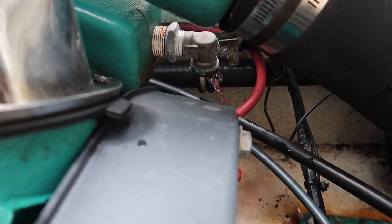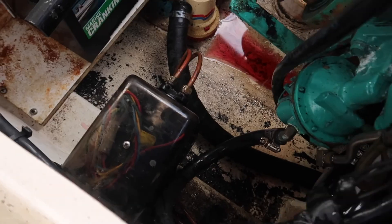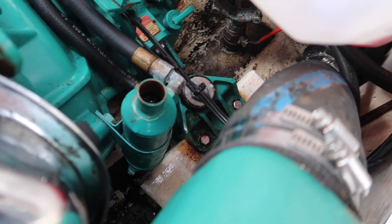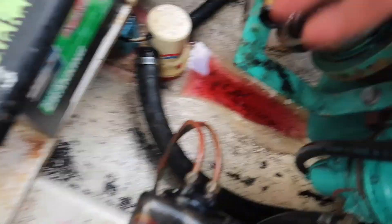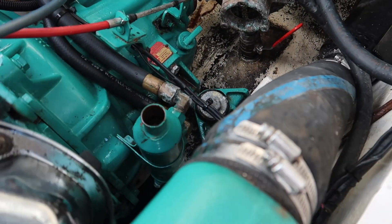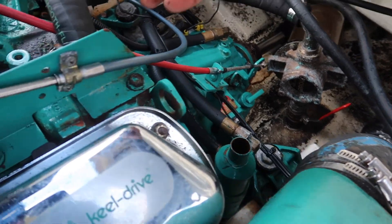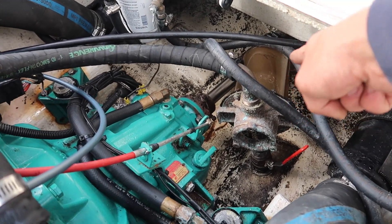The last thing: this hose runs up to the power steering cooler, so I'm going to dump some antifreeze in there just in case. You can see it's coming out pink — now we know that whole line is done. That's not strictly necessary but it's an extra precaution. Then I'll dump some into the strainer so it goes through there too. This is a general guideline — this is how I do them all and I've never had an issue.